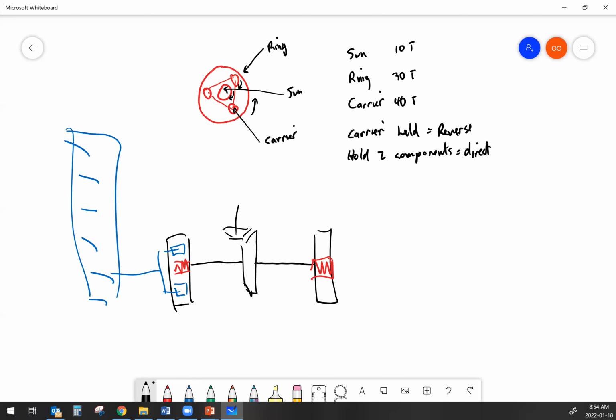It's surprisingly simple. I take a hydraulic motor, a steering motor, okay? And that motor is going to be connected to what's effectively a little set of gears here. I'm drastically simplifying what actually happens here. But basically, if this hydraulic motor was able to turn this shaft, and if that shaft was coupled to the ring gears, if the outside of the ring gears actually had gear teeth on them instead of being just part of the trumpet housing, that would mean I could take that ring gear and speed it up or slow it down by speeding up or slowing down the steering motor.